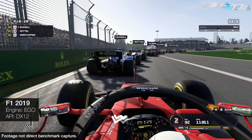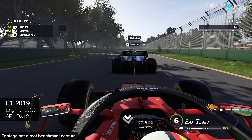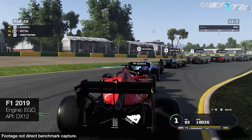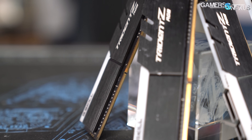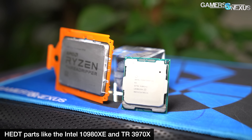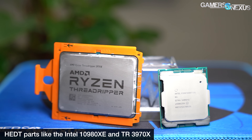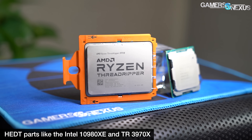The 3866 MT/s memory is a 4x8GB kit, but for convenience we initially chose to use only two sticks. None of the gaming tests we run really require 32GB of memory, but we run a 4x8GB kit for reviews for a few reasons. It's typically easier to get stability with two sticks instead of four. The two reasons we use 4x8 for reviews are: first, some enterprise tests like Chromium Code Compile require more memory and will page out to storage without it; and second, we prefer to use the same kit across as many tests as possible, including quad-channel HEDT CPUs.